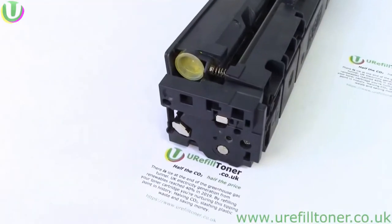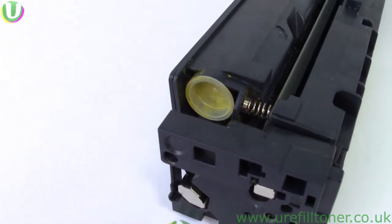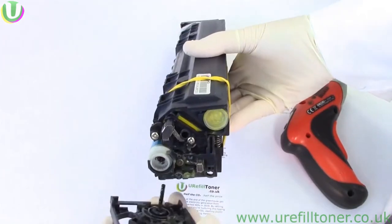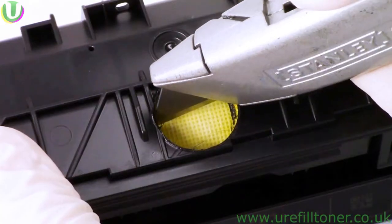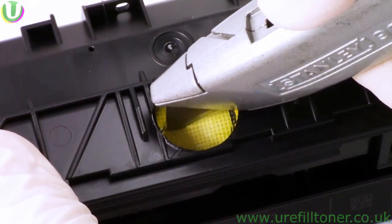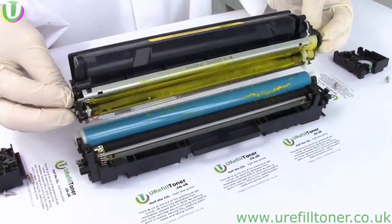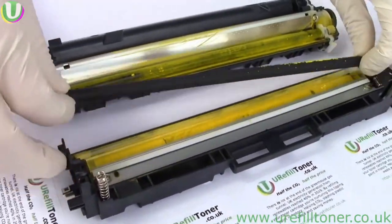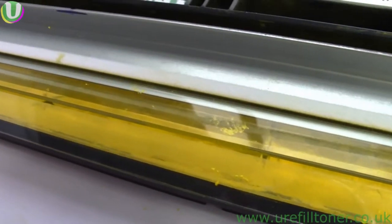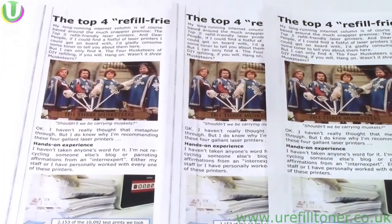In addition, they're actually much better for refilling than the HP original cartridges. As you've seen, they've got a refill plug that's reasonably easy to get to. They've got no inner toner bag, which really impedes the ease of refilling an HP cartridge. And they've got bigger waste compartments, so you can get a lot more printing done on refills before you run into the kind of vertical streaks caused by waste overflow.